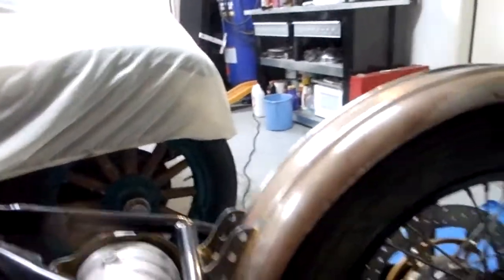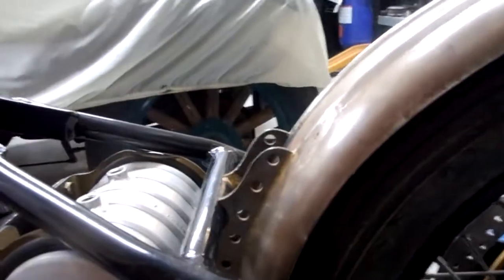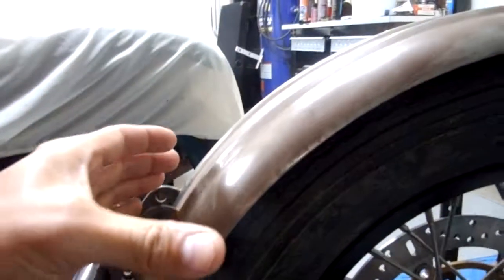There's a real trick rear fender setup on this — it's a dual rear fender done in an old-school flat track race style. I fabricated these brackets as a quick release setup: you just undo the Allen bolts and the whole rear fender slides back over the wheel. It locks onto the frame up top, and all you have to do is take off two bolts and the rear fender is off the bike.